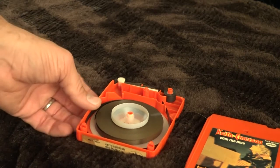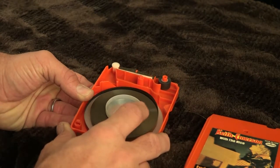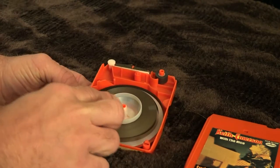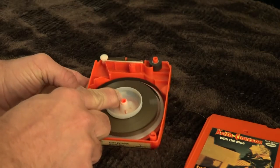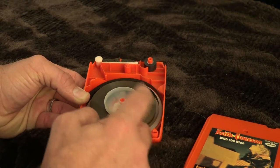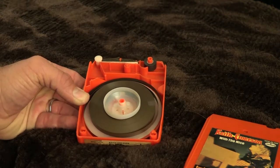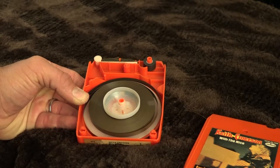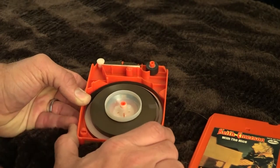This tape — we're going to need to replace the silver tape that's normally in the middle of the recording, or at the beginning when you do your program change. It's down here on the hub. You can see that shiny part there. It's snapped and been pulled into the reel. So what I'm going to do is use an old reel-to-reel I have that doesn't work, and wind this tape off onto its reel by hand, then get that end out, roll it back, and splice it onto this original reel.